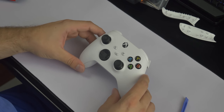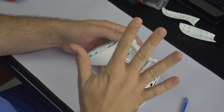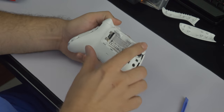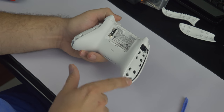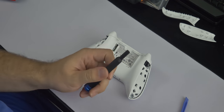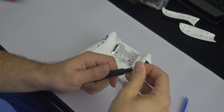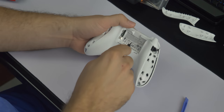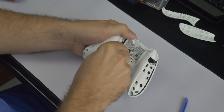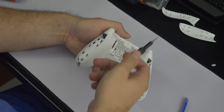So we have our controller here. Before we open it up, we need to pull off this back piece. There are five screws on the back of this controller to actually open it up and get inside — one here, one here, one here, one here, and the fifth one is actually hidden behind the sticker. So what you're going to do is take your iFixit screwdriver, take your bigger hex screw, plug it in there, poke to find the hole, and it'll just break right through — pretty easy. You can actually rip off this tape if you want. From here we're just going to unscrew these screws.